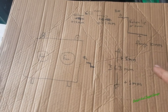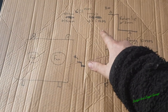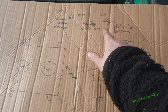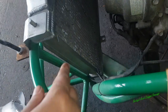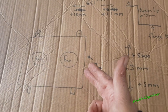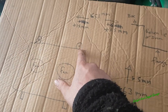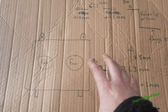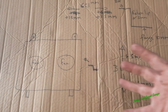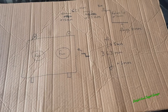I don't normally do this - I normally just have it in my head and make something - but because of the video I'm explaining what I'm doing. On the sides we're going to have a return flange of 5mm, then a flange of 10mm which will line up with the existing flange and allow me to put a couple of cable ties along the side. On the top we're just going to have two 5mm returns. That will give us an open box, and when the fans turn on all the air goes straight through and out the other side, cooling the car down really quickly.